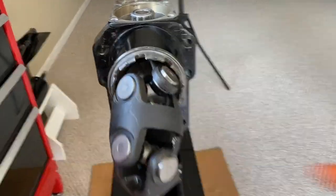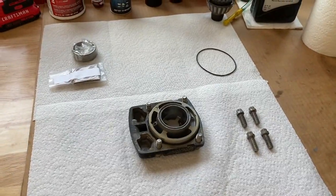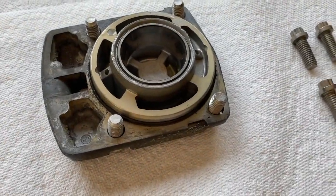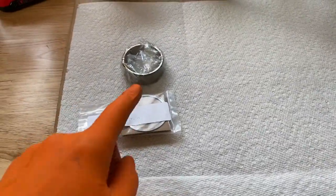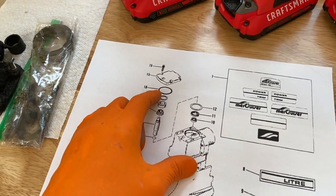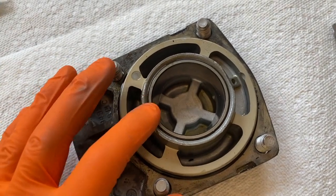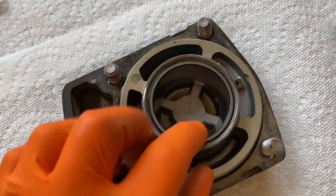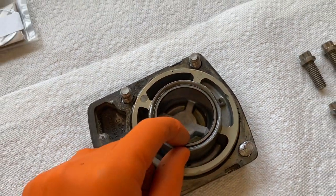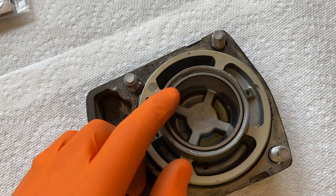Take a minute and double check everything is properly completed with this portion. Now it's time to install the upper cap. I've got a new O-ring and four new bolts. Here is the top portion with the original bolts and O-ring, the new bolts, the new O-ring, and a spacer and carrier. The bearing is already pressed onto the shaft by the local marina — I cannot take that off. The carrier and spacer are already pressed into the underside of the cap and I cannot take those out without the proper tools. If your carrier is still in really good condition, go ahead and use it. If you see any scoring, scratches, or gouges and polishing it out does not help, it may be time to replace the carrier and inner spacer.